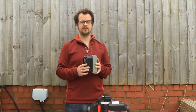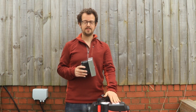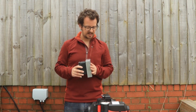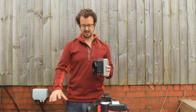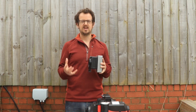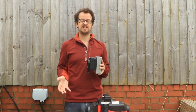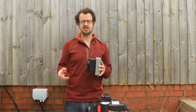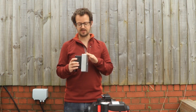So should you add one of these to your van build? The simple answer is it's totally up to you. We've been using the 2 kilowatt heater here. We will do a test on the 5 kilowatt as well, but for the 2 kilowatt, if I had a heat exchanger to put somewhere and I had the Bubble system, I would add this to the regular line of heat exchangers, because there is so much heat that comes out of the body of the heater I don't really feel like I need to go after the exhaust gases as well. However, if I already had two heat exchangers and I had a third, there's not much point putting it in line because I've already reclaimed most of the heat there is anyway.